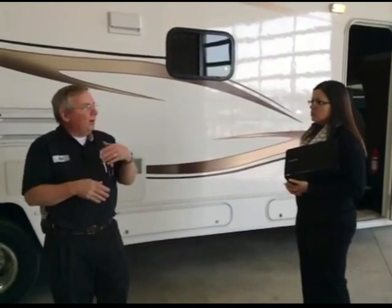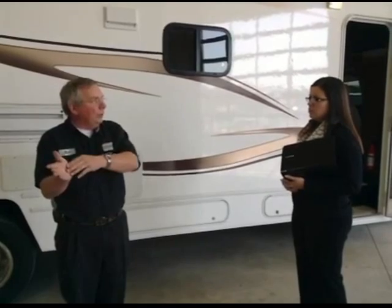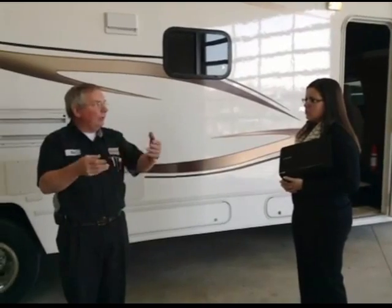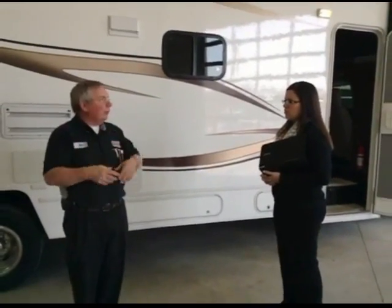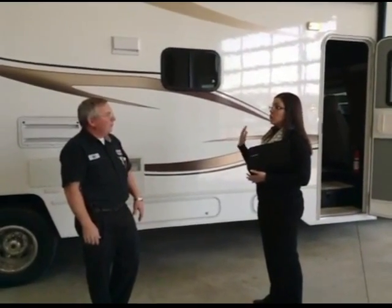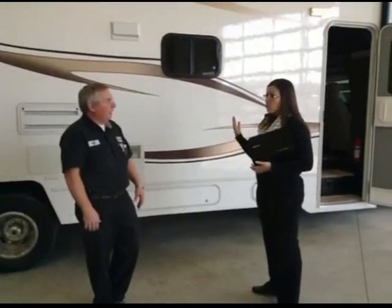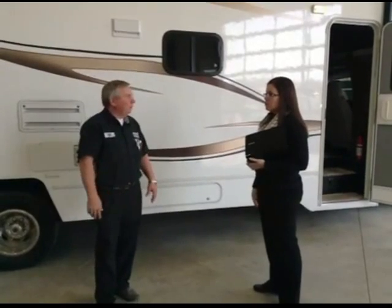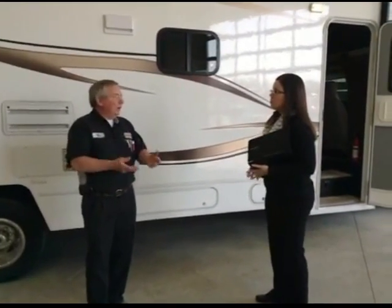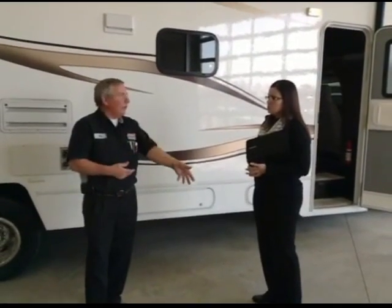Make sure that when you're running your washing machine, that you run it on the cold side. Make sure you're getting all the pink out of the cold side, and then turn it off. Make sure when you turn it back on, it flips to hot, and flush that line out too, because you want to flush both lines out. Yeah. Right. And warm might take a couple cycles before you do it. But if you go all the way to cold, it'll only run the cold. If you go all the way to hot, it'll only run the hot. And if you get them flushed out, then your first load should be fine.